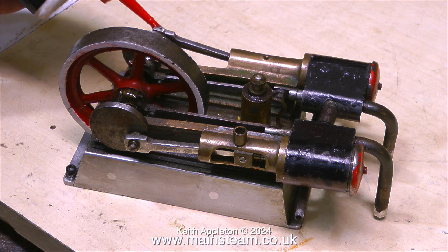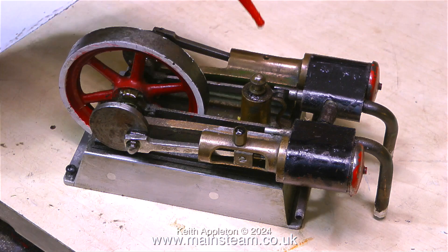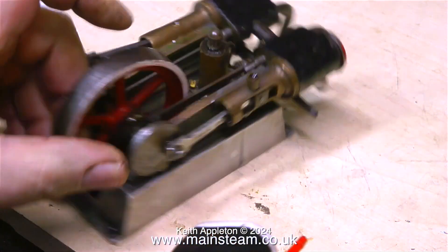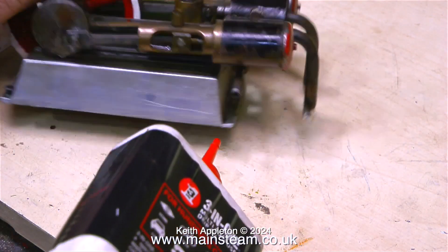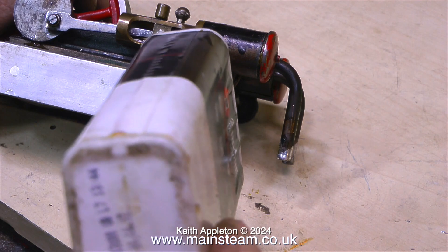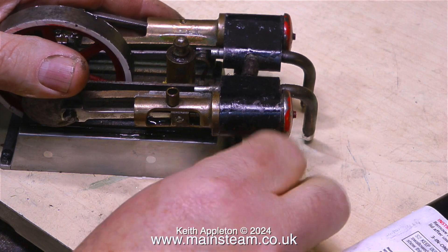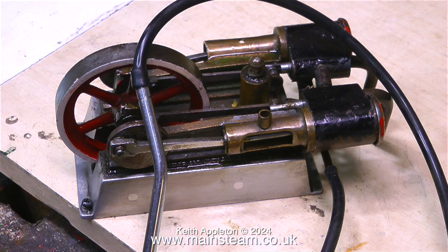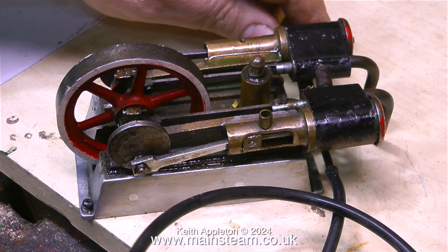The first thing to do: flood it with oil. It's anybody's guess how long it was since this engine last ran, so treating the engine to a copious amount of machine oil is a good idea at this stage. I'm trying not to miss anything, and the oil's going everywhere, which is not a problem because eventually this engine will either go in the bin or into a bath of cellulose thinners — known as lacquer thinner in the USA — to remove all the paint. It looks like it's been painted with a tire brush, but first I need to make sure the engine works because if it's beyond economical repair it's really not worth working on.